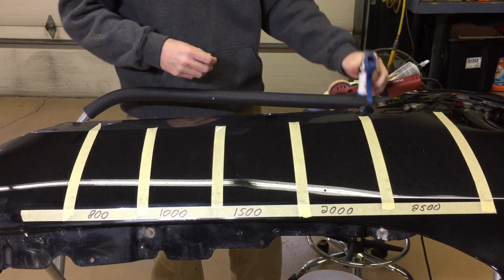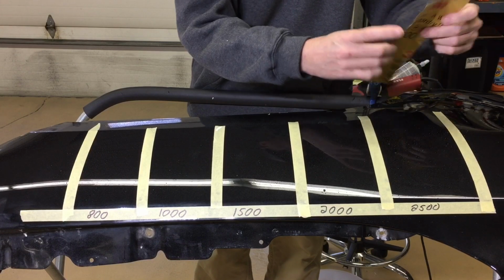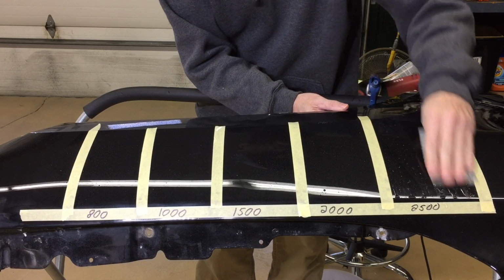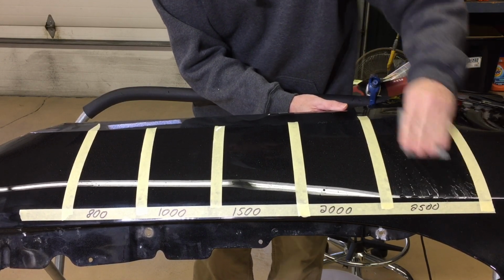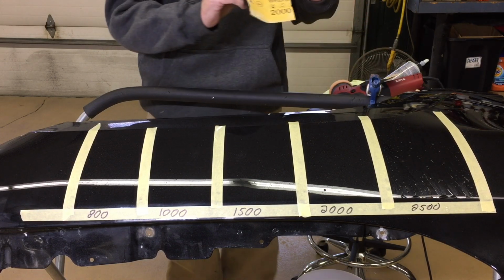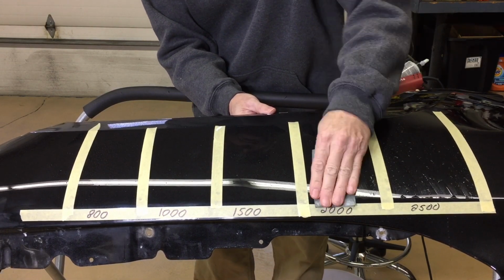When it comes to the diminishing abrasives, I put a little bit of the product on the panel here and spread it out. You can see the abrasives, and I can also feel them between my fingers. Now, who knows, but for the most part, when I can see them and feel them, it's going to leave some dusting behind. We're going to test that thoroughly here on a panel and also out in the shop. It's not always the case that we find some dusting when abrasives are apparent in the compound, but it has happened in a large portion of the compounds we have tested. I really hope that dusting is absent from this compound. The dusting and residue really drives me nuts to begin with, so it's a huge part of compounds that I choose.